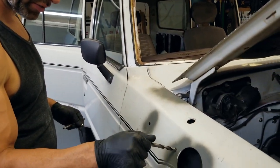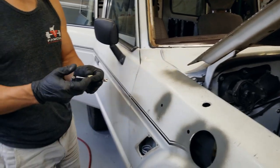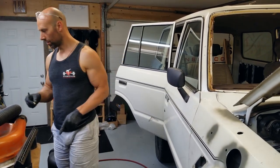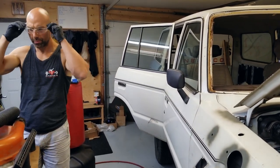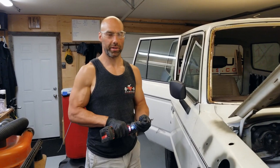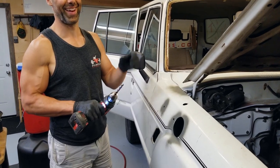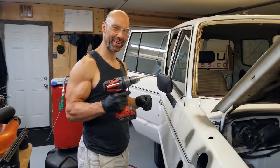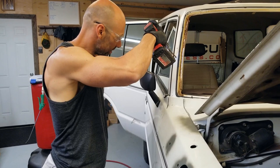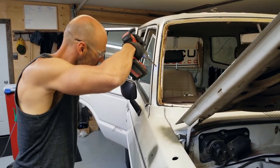The 3/8 drill bit - you can see this doesn't even fit in there, so I'm probably fine with the 3/8ths. Kind of like being a carpenter - measure twice and cut once. No mistakes. We'll drill twice if we have to. When drilling with a big bit, use slow speed and some cutting fluid if you have some.